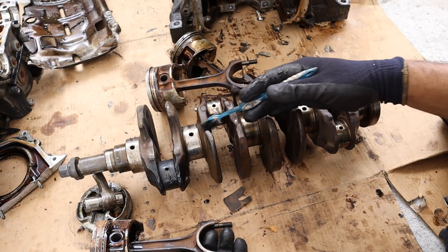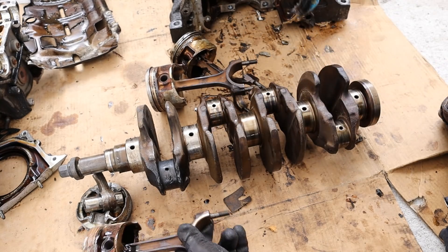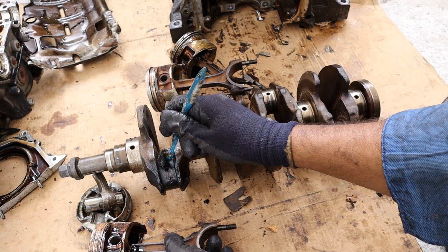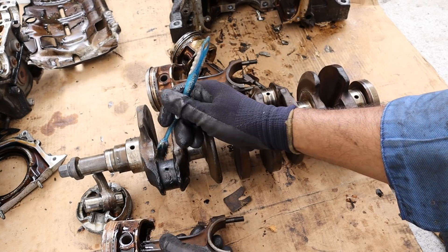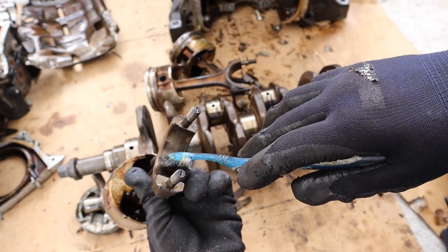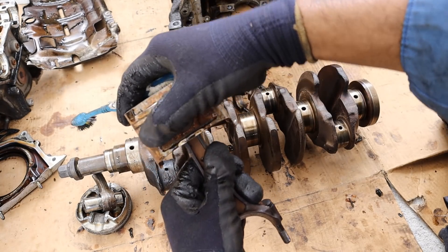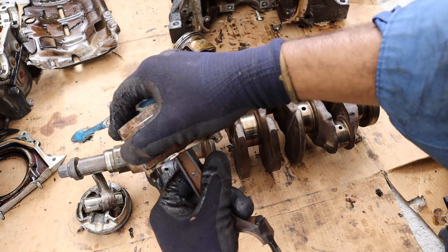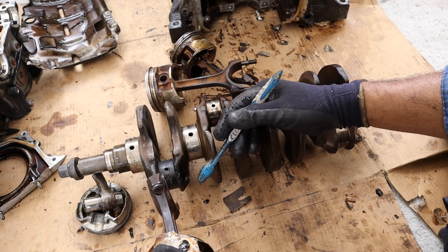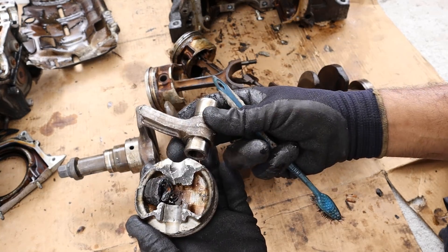Taking a look at the crankshaft, we've got our typical 4 cylinder iron crankshaft here. I did find some coolant in the oil pan, and when coolant and oil mix they don't lubricate very well. When that lack of lubrication reaches this crankshaft, we've got our main bearings that feed our connecting rod bearings — which are arguably going to be hotter near the combustion chamber. This is going to overheat, and that's why this area is completely black and darkened up, because this bearing completely disintegrated. Moreover when this bearing is completely overheated and cannot get any more oil, this little hole is supposed to squirt oil up at the wrist pin to keep it well lubricated. And that's how you can see for the remaining 3 cylinders there was no oil getting up to those wrist pins and they're completely seized up. What happened over here is you've got so much friction and heat going on — something's got to give — and that's when your connecting rod completely decides to disintegrate because it's trying to push against friction and blow the engine.